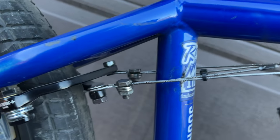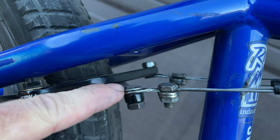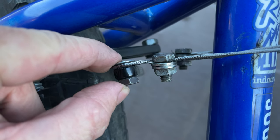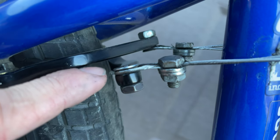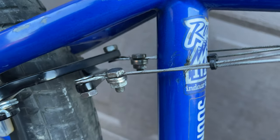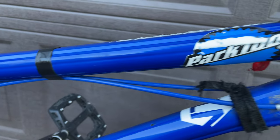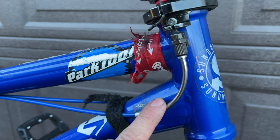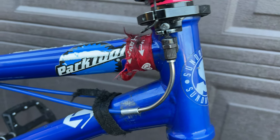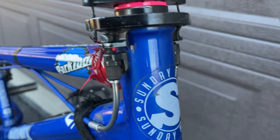Very interesting here. I also just remembered something I should point out: I have the ends of the bolts on opposite sides of the brake arms so they can be more level. Obviously if both were on the same side they'd be way off and would probably pull very strange. Moving forward, I've got v-brake noodles — these are very common for gyro users. Nothing crazy there but I feel like they do help and make for a more solid brake pull.